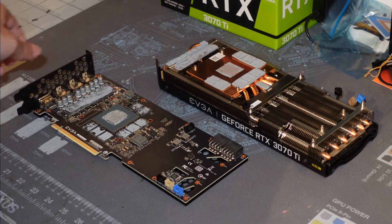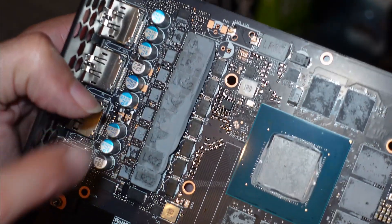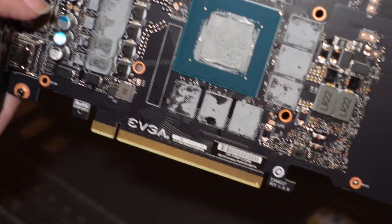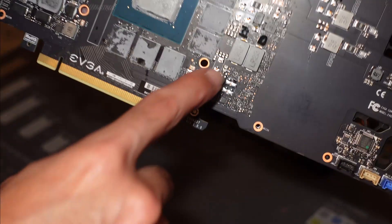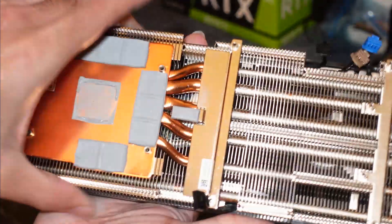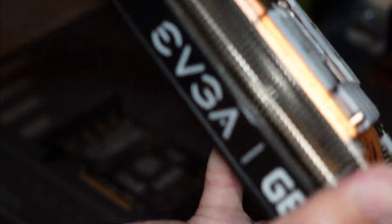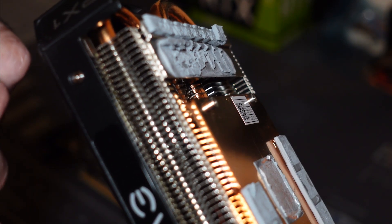I knew this was going to happen — the thermal pads ripped, which is why we're going to replace them with thermal pads from GPU Risers, the one over the inductors. Because this GPU got so hot, the thermal pads kind of adhered to the memory module. So we need to clean and scrape all that off. There is a thermal pad on the cooler that goes over the inductors, but we don't need to worry about that — there's a good one right there in the middle. The ones along the side definitely need to be replaced. This one looks like 1.5 mm.